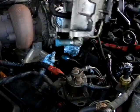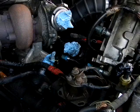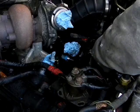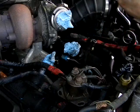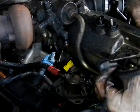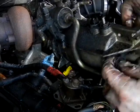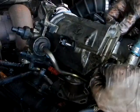And you got your fuel bowl free, and you got some wires hanging out there. And that connector, it won't go through there. People always ask me, what do you do about that? Well look, there's only one real thing that you can do about this. Take that nasty 8-pin connector off your IPR. Unplug your fuel bowl heater, water and fuel sensor, and just pull that right on through there. And this one right here is liable to need to be replaced. And they're not cheap when they do either.